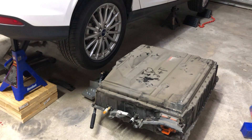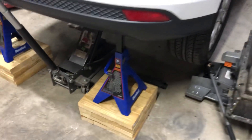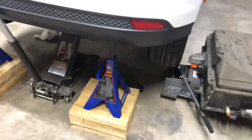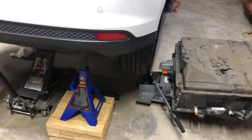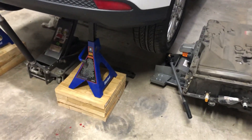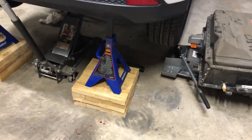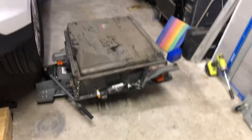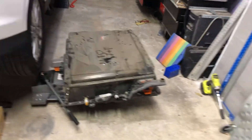To do this job you have to lift the car quite high — look at that. I used a jack and made two bundles of blocking — what we call cribbing — four layers of cribbing screwed together underneath. The jack stands are almost at maximum height, and the Harbor Freight transmission jack is the bee's knees for this job.